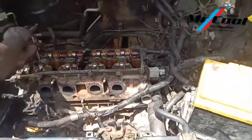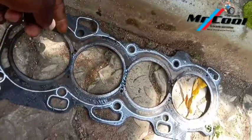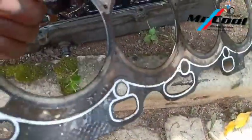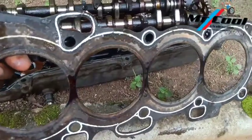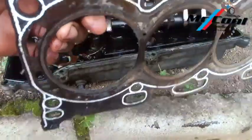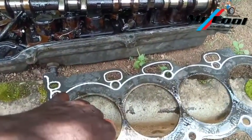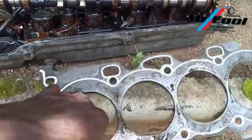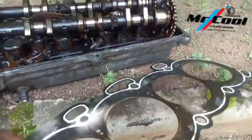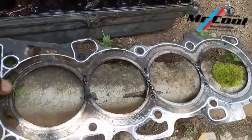Now let me take you to the other side. This is the gasket here — if you look carefully you're gonna see some bonds in the middle which are discolored. That's what you're gonna see on any car with a blown top cylinder head gasket. On this engine it's not that the car won't start — most times when it blows the top cylinder head gasket, if it's too bad, the car won't start because it loses a lot of compression from one cylinder to another.